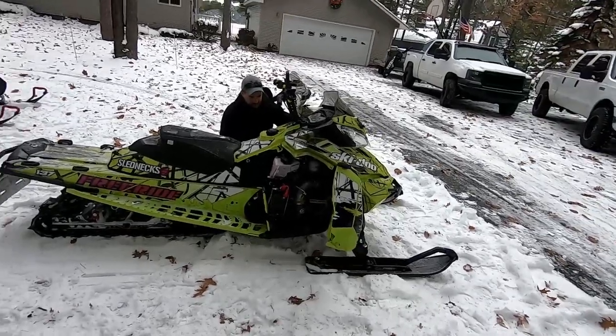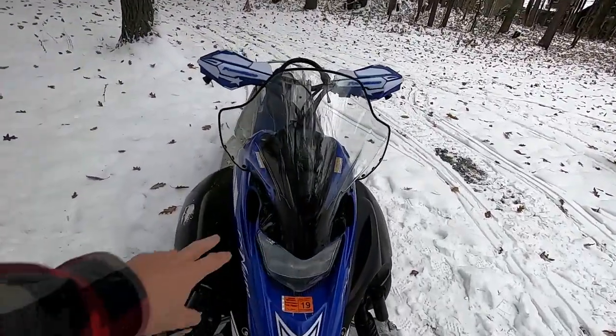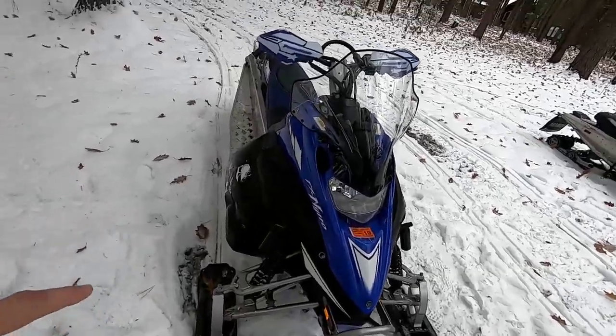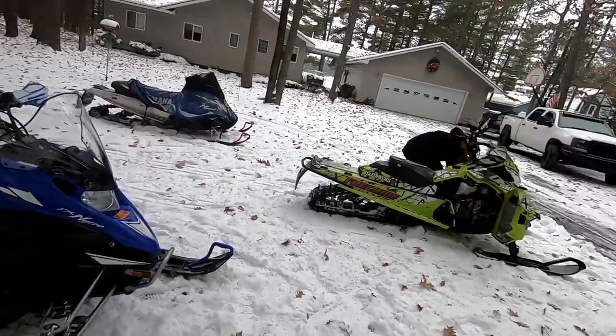This is Tim's new sled. I'm also going to be changing out this windshield, and then my starter hasn't been working — it's not the starter that's shot, it's actually the starter relay, so I need to get that changed out. So we're going to be doing some work.